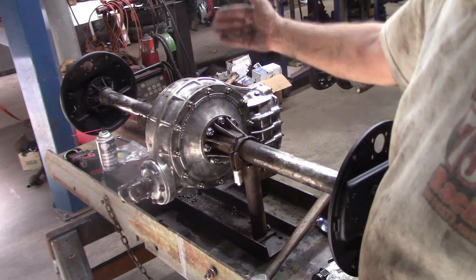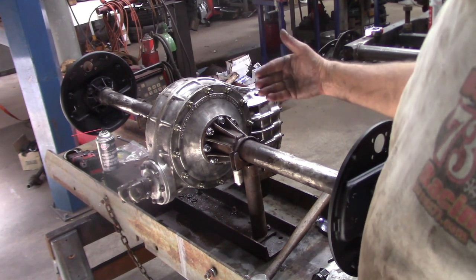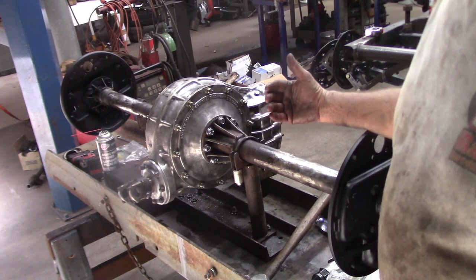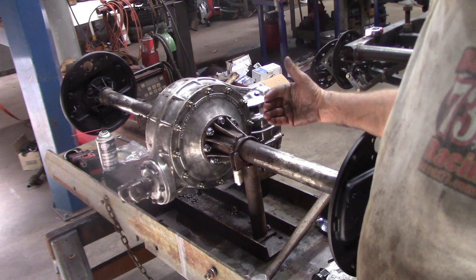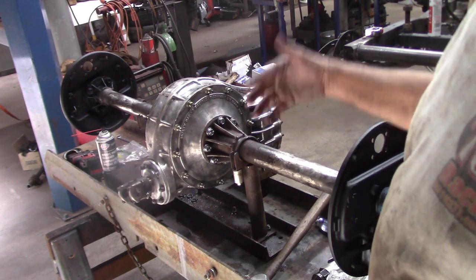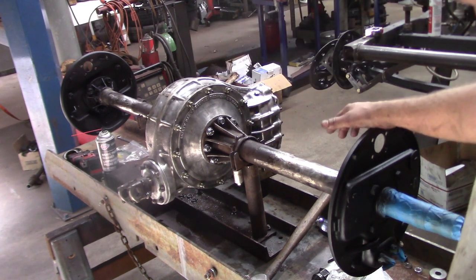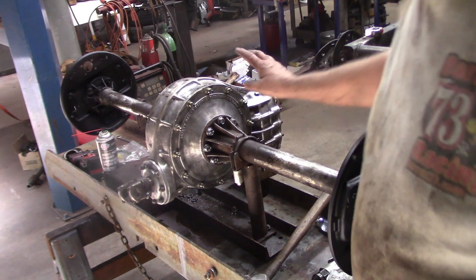What I also found out is the wrong seal was in there. It was for the wrong diameter axle. And I think in the 11th hour, slapping this thing together before a race, they found whatever was available. They put a seal that was designed for a 1 1/4 inch diameter axle when the axle is in fact 1 3/8. So I'm thinking they just said, well, it's close enough, it'll wear itself in. They probably got away with it for a while. However, eventually it did lead to filling the axle tube up with oil and contaminating the brakes. So, new seals in place,